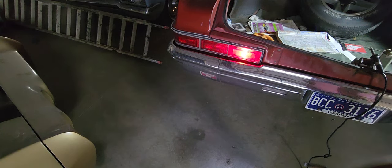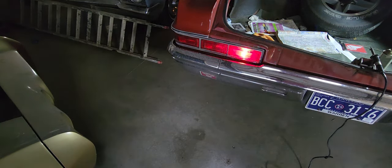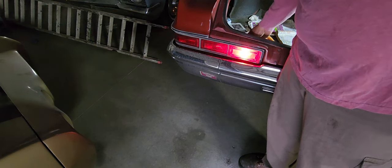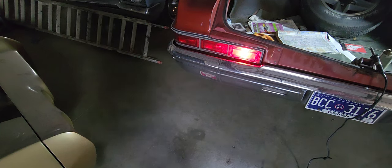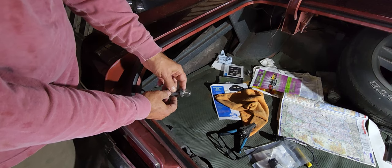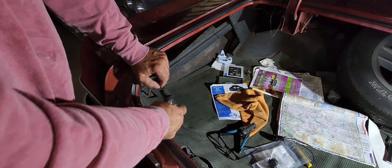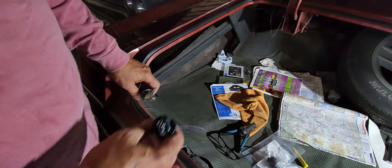As you can see, my left side outside light doesn't work. If you just touch the wires the inside light comes on, so I have no turn signals. It came back on — yeah, that's pretty cool, usually it goes off and doesn't come back on. There's nothing broke about it; it's just that the connections to the socket have gotten old and you can wiggle the wire until it's a little bit loose within that connection — that's what the problem is.